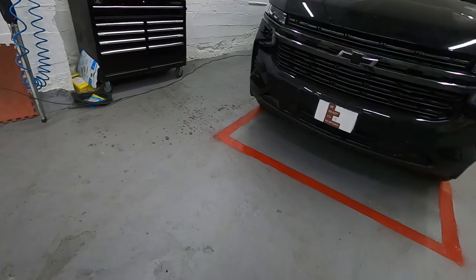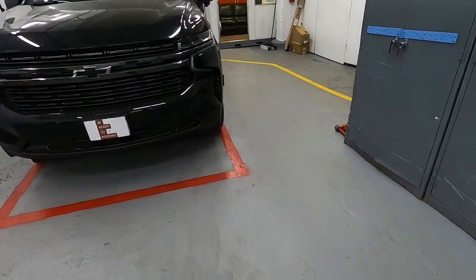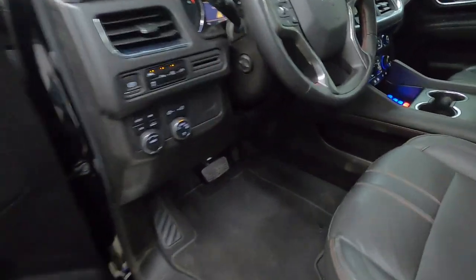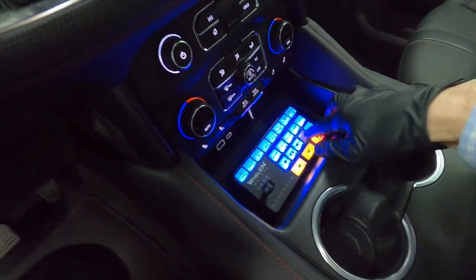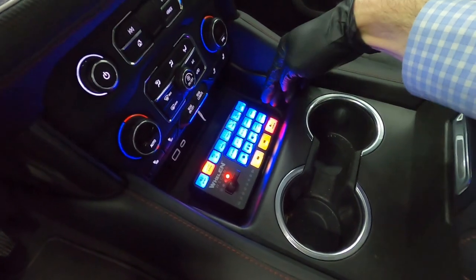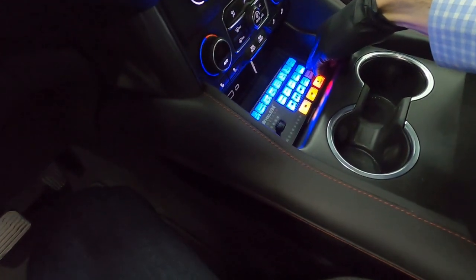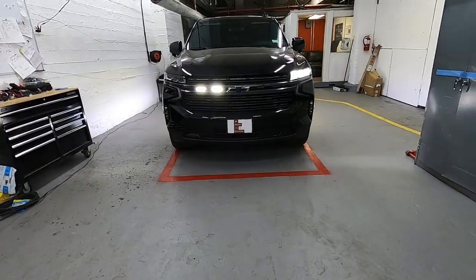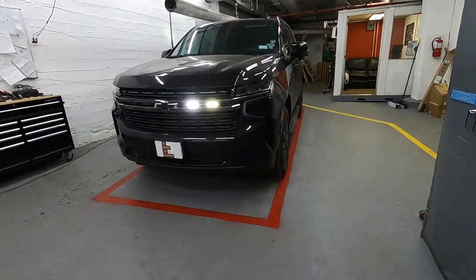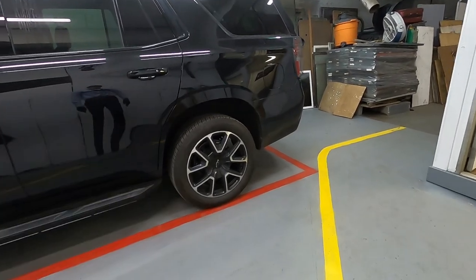Front flash — check this out. Front flash turns on the front floodlight in flashing mode. The reason we put that on a separate button is because we don't want it to always go on whenever the customer is responding. We want the ability to turn it on, but not by default — so the customer can add in the front flash for more of an effect if they want. Next button is clear, which adds a little white flashing: the grills in white, the front high beams, the front wheel well area. It does not add in the front interior bar per the customer's request. It flashes the tracers in white and the third side window in white, but doesn't do anything in the back.